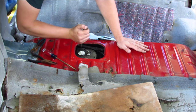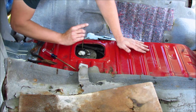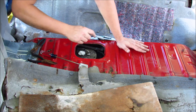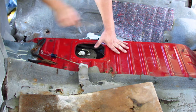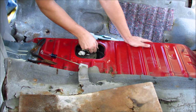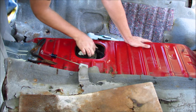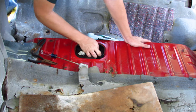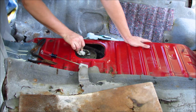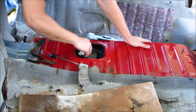There is a gasket material between here, so make sure the gasket itself is located so you're not trying to thread through rubber, because that's not going to work out too well for you. We've got all of our screws tightened. It's time to put the hoses back on and the hose clamps — don't just put the hoses on. I'm trying to be very careful with some of these old lines, as careful as I can be. This one's a real tight bend though. Go ahead and tighten up our hose clamps.